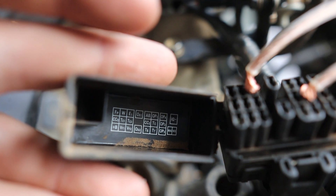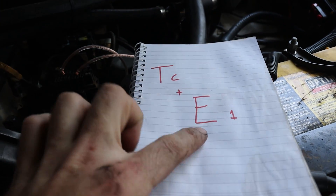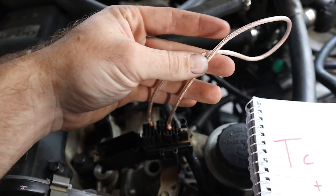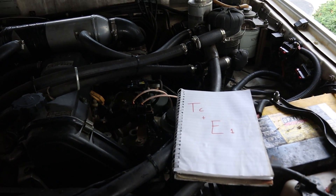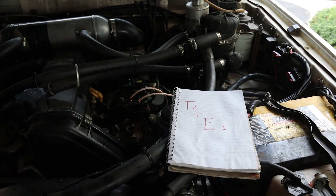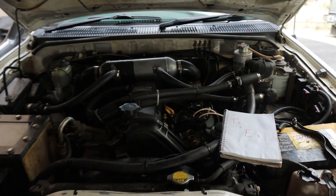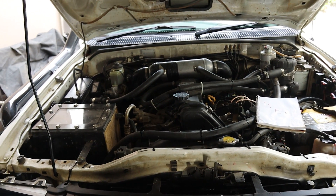You can see all of these pins are labeled on the underneath of the cap. What we want to do is bridge TC and E1, which I've done here with a piece of wire — you can use a paper clip, whatever. That's going to put the engine in diagnostic mode. Then you've got to Google each error code depending on the flashing lights. I'll leave a link in the description to a website with all the error codes and how to read the blinking lights. For me, I don't have any issues with my engine, so there are no blinking lights to actually show you.